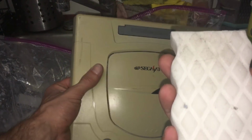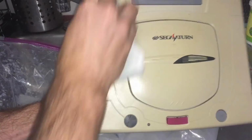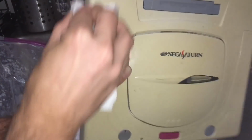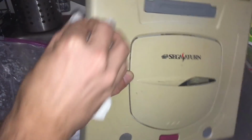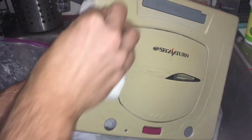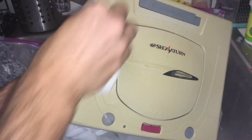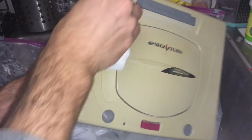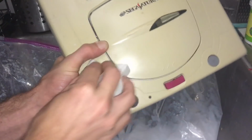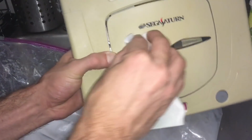This is the Mr. Clean Magic Eraser. But the things that do not want to wash out, let's give it a go. Now this is something you don't want to use on painted consoles. Sometimes you can remove the paint job, like doing this on a GameCube. Not good. Doing this on a PS2 works fine. Original Xbox works really well to get out those weird white scuffs that those things get. Yeah, it works good on a lot of things. Works really good on Dreamcasts. Only thing I wouldn't recommend using it on that I've used it on and regretted was a GameCube. It did not turn out well.